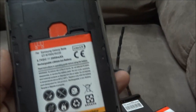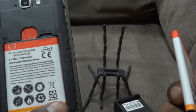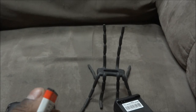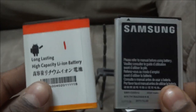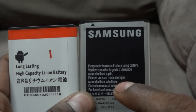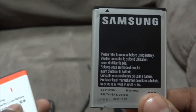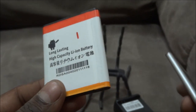These batteries tend to give me about 20 to 30 hours for moderate use. For better comparison, the original battery that comes with the Galaxy Note - I've run battery tests on both. When brightness is left at 100% and I run a looping video with 3G and Wi-Fi disabled, I get about eight hours 45 minutes to nine hours of looping video playback. Whereas on these aftermarket batteries I get about six hours.